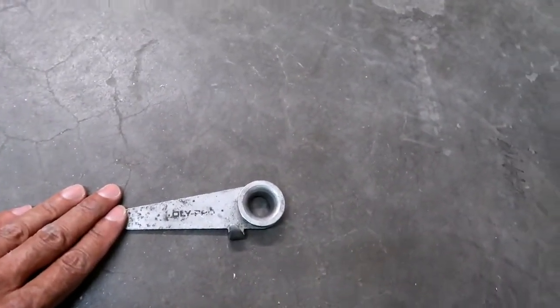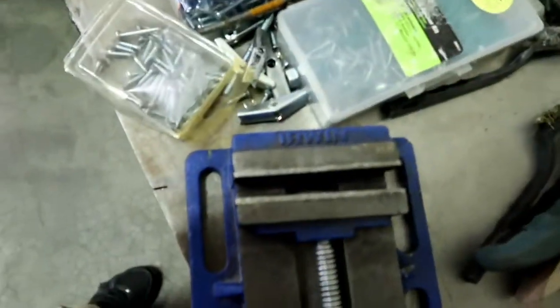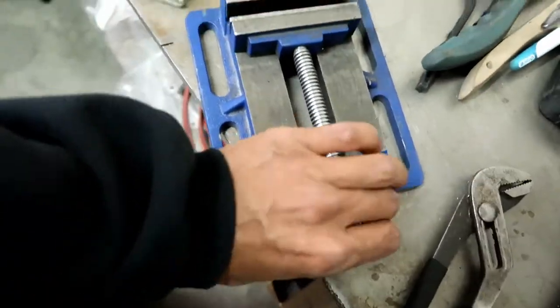I think I can use that one as a template to bend this one. I've just been using my little tubing bender here and a tape measure to get my stuff going. It's just tedious trying to straighten out some of the kinks on this one that I don't need. I've been using my little vice over here — excuse the mess on my table, I've been reorganizing my tools. I just put the line in here and kind of straighten it out a little bit, just apply gentle pressure — you obviously don't want to crush the tube. It's a little sketchy, I'm not gonna lie.